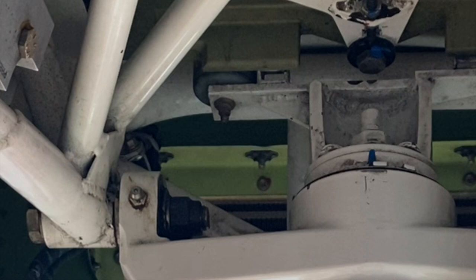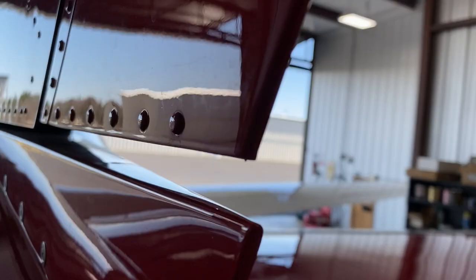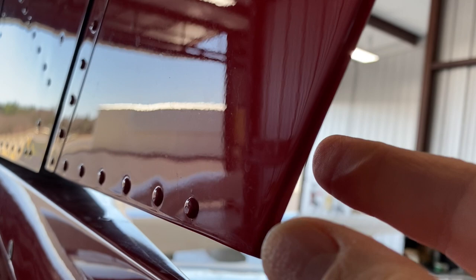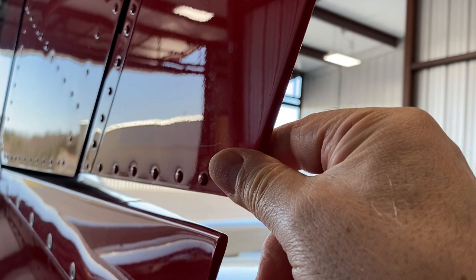The clearance between the steering arm and the rollers is very small. The allowable distance is between a quarter millimeter and three quarters of a millimeter on each side. By moving the rudder, we're making a quick check that the gap is in the correct range. If there is too much play, we must crawl under the wheel well and look for the trouble. And also, if there is no play, we need to crawl under and look for the trouble.